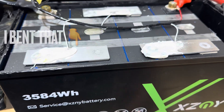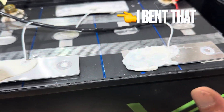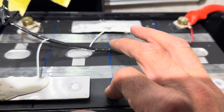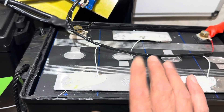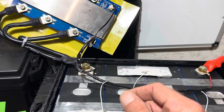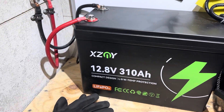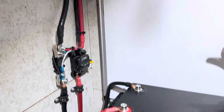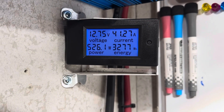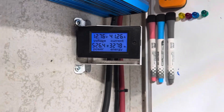Showing more detail on the 280 while the 310 continues its capacity test. You can see the laser welds — very professionally built — with cell-separator material between each cell. I haven't found anything to knock it on; it's meeting or exceeding my expectations. Back on the 310 test: the golf cart has entered the constant-voltage phase and the current has started to taper down. 3,278 watt hours delivered so far with more to go.